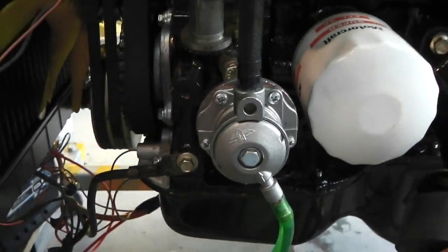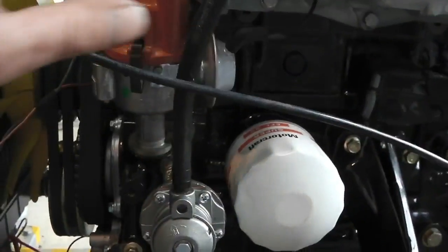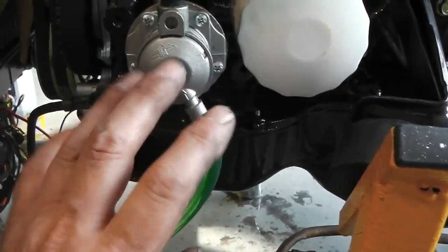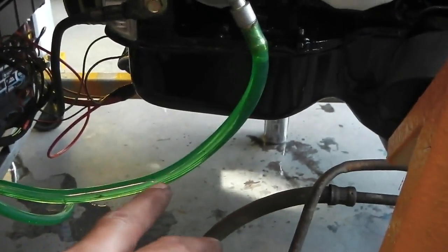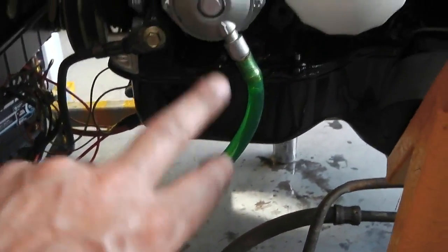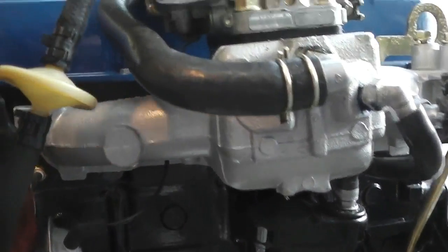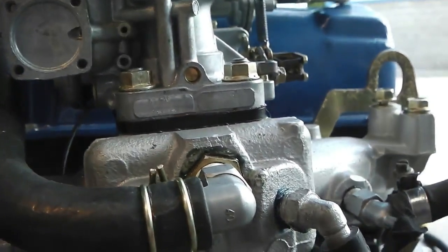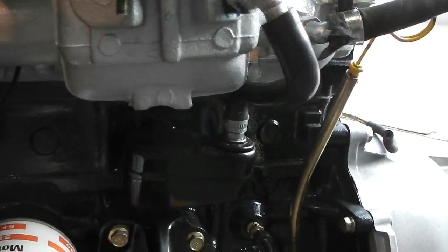Then you got us to part 35, where I was putting the fuel pipe on, having done all that, letting the fuel come through this pipe here. Now, that was bone dry, and I was only watching the fuel coming up like this, but thinking back, there must have been traces of fuel ahead of the main line of fuel that I could see, and I think that got in there and very quickly got into the carb. Now, there's the float chamber just coming up underneath here. That must have quickly filled, and before we knew it, the engine had fired up.